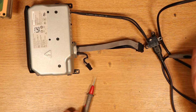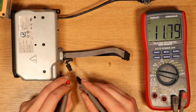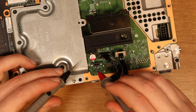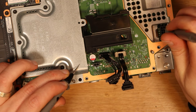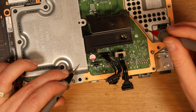I'm going to test another power supply that I have for an Xbox Series X — hopefully I can just put this in and maybe it'll work. I didn't know the issue was going to be a faulty power supply; I thought it might be a short on the 12-volt line. I've plugged the known-good power supply in and I'm just going to test to make sure we get 12 volts — and this time nothing blew up. We have 12 volts on both cables. I'm also going to test and make sure we don't have a short on the 12-volt line on the top board — we don't. Checking the bottom board: left is negative, right is positive 12 volts with no beep. So we don't have a short on either of the two boards — that's really, really good.